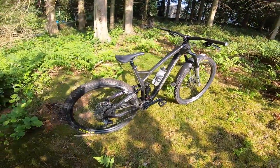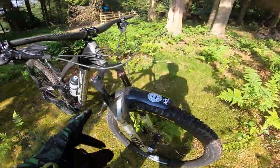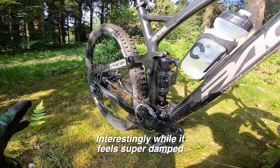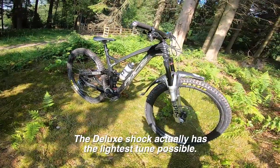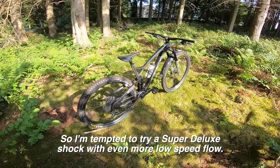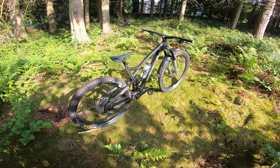Hopefully that was a lot easier to watch and listen to than the previous horror. Learnt a bit more about the bike. That shock tune on the fork is definitely working better - as you can see, even with the two tokens in, I'm still slapping through to full travel. ShockWiz says I still need to lose a bit of air out the shock. Otherwise it's pretty well dialed - it's definitely a very damped, race-tune feel, but with the stability and the geometry length of the bike, it's just been so utterly calm and confident, even properly pinning it on sight-unseen trails. When it gets the chance to hit some open trail, this thing is absolutely warp speed.